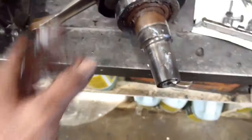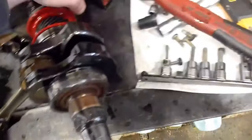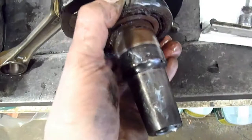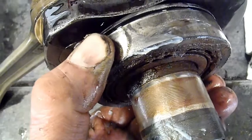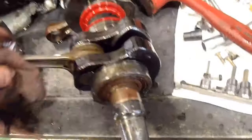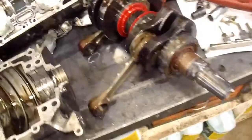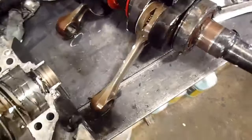It does come with a warranty even if I install it myself. I don't have to worry about it if we get way back in the backcountry - I don't have to worry about a crankcase failure or a bearing failure and then a heli-lift out, which is going to cost just about the same as a crankshaft anyway. This inside bearing has play in it - that's loose. Look at the grease in there - nasty. That bearing is loose. I think I made the right decision by doing this. It's unfortunate because this crankshaft looks like it's in good shape. I was going to check the runout but I'm kind of in a hurry, so I'm not going to check the runout on this crank.